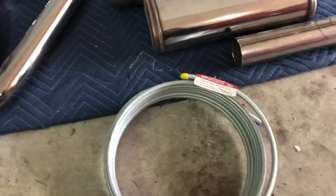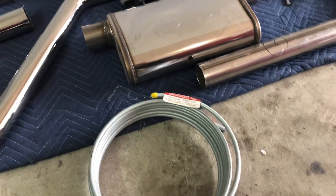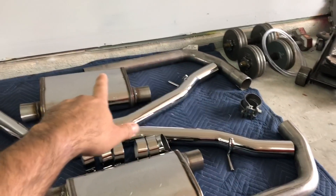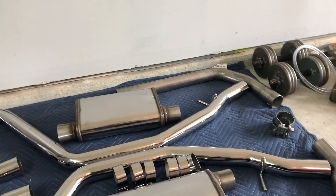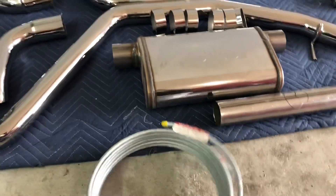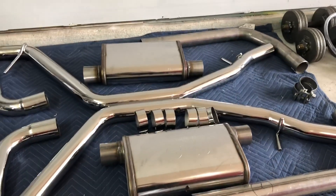What I'm gonna do is use some of this bent-up fuel line pipe here — I'm gonna bend a piece of this tubing to match whatever bends I need on that pipe, then take the pipe by itself to the muffler shop and have them bend it to match whatever shape I bend this to. I'm gonna go ahead and install this right now and then start bending and matching it. Sometimes you gotta take matters into your own hands — I was hoping to find an exhaust shop to bend my pipes from the header to the muffler, but no luck.